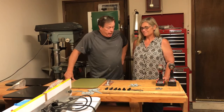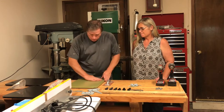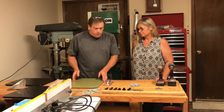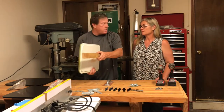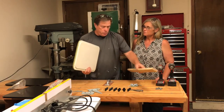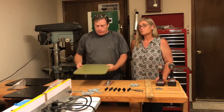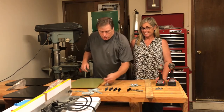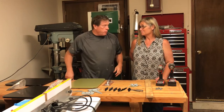So today, we get to put all these panels and doors on. All we need to do is put them inside the openings. I'm gonna screw this piece of wood to the back to sort of hold it up against the inside of the trailer where we know it needs to be. Put shims around the perimeter to hold that door exactly where we want it, and then fit our hinges for these. Put them in and move along.